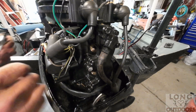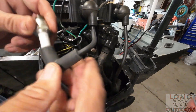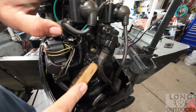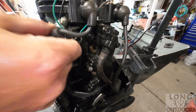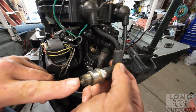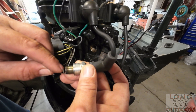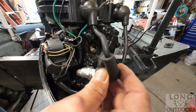Make sure the plugs are gapped to the manufacturer's suggestion. These plugs are supposed to be 1.5 millimeters, so that's very important. Take one of your plugs, put it back into your wire and make sure it clips on. I sacrificed this bolt here to act as a bare metal ground - if everything's painted, just hit it with sandpaper and a brass brush. Turn off the lights and you should see a spark jump between the electrode and the top. I hit my starter and saw no spark jump at all.